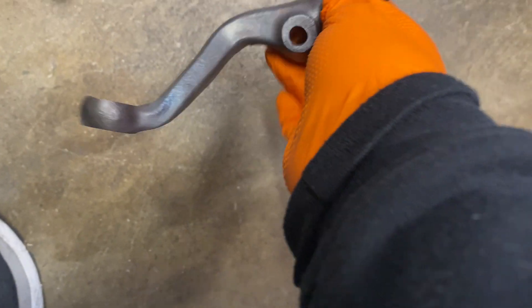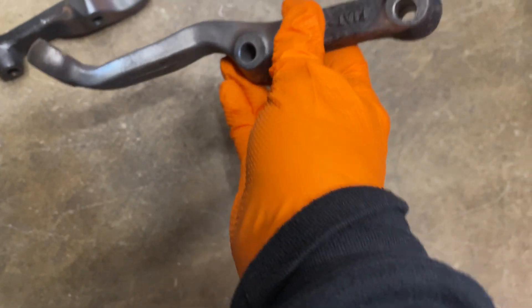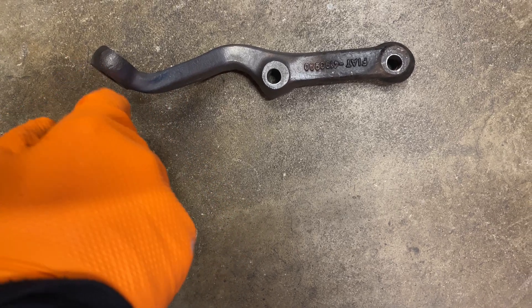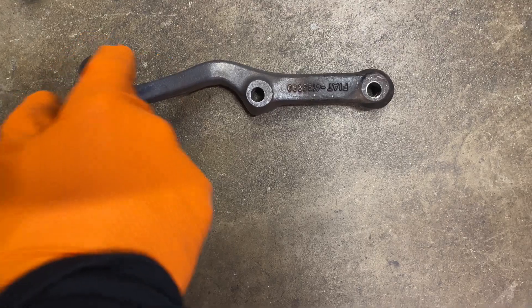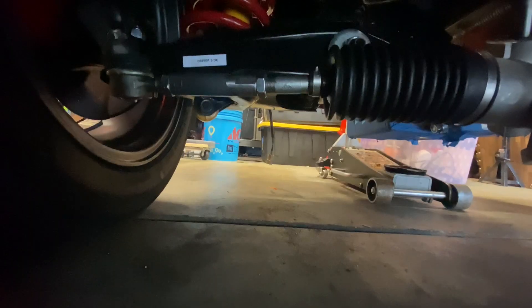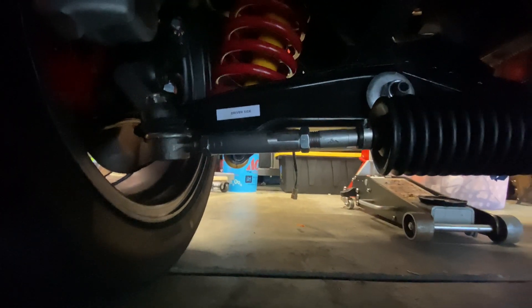Here's an update — I had some modifications done to the steering arms that attach to the inside spindle of the wheel. Essentially what I did was bend these to drop them down about two and a quarter to two and three-eighths of an inch in height, to ensure I had enough space to make up the distance I was losing. You can see the ball joints attached there, and with full load I still have a little bit of space to drop, so I could potentially lower the car a bit more.